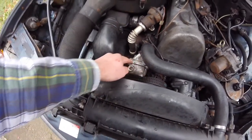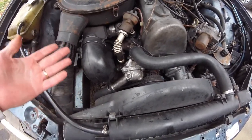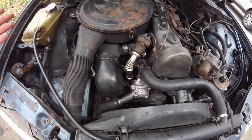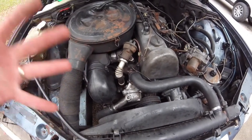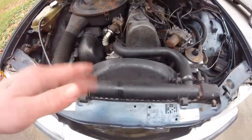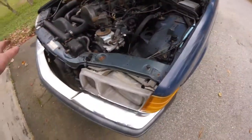I was having an overheating problem. It didn't get into the red when I had the heat on, but if I would turn the heat off, it would. So I put a new thermostat in there. The old one looked fine, but the problem is it sat there for ten years. Without getting opened and closed, it kind of just congealed closed and wouldn't really open. So far, that's been working for me — I'm going to keep my fingers crossed that that was my issue. I've also done bulbs and stuff.